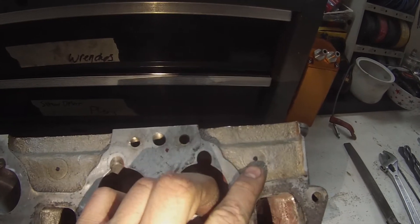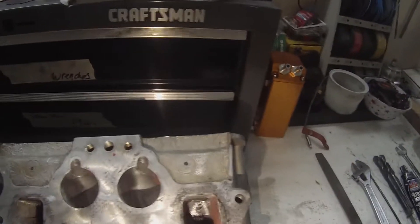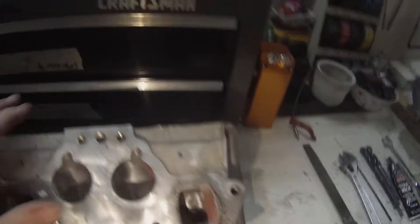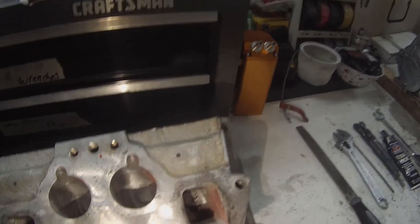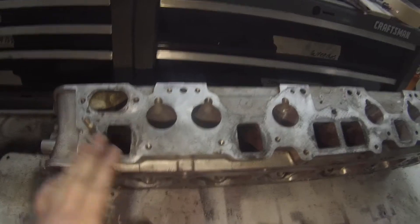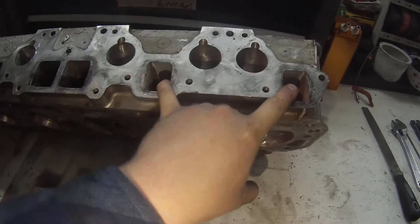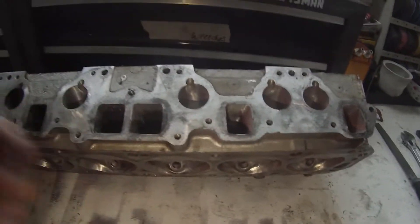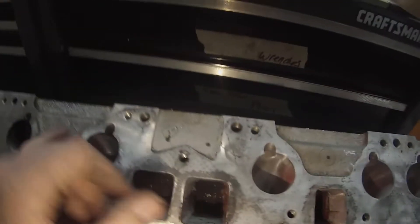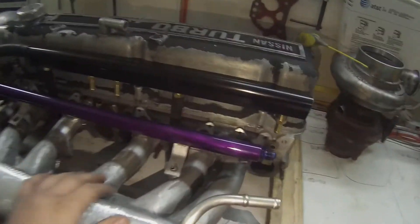So we're going to do this mod. We're going to drill into the passage here and tap it for a quarter-inch NPT to three-eighths hose barb fitting. Three-eighths is a pretty good size line for flow, and if you want to get fancy you can get a dash-six line and do braided steel. Essentially what's going to happen is when the coolant flows through the block into the head, it's going to exit out here — hot on five and six. So we're going to reroute the way the coolant exits the cylinder head. We're going to drill the holes out, the coolant's going to come out of these fittings and go into the bottom of the thermostat housing.